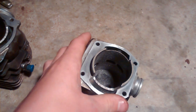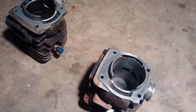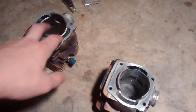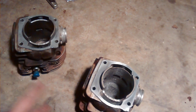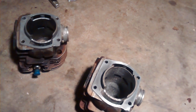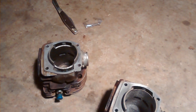My 372 I just rebuilt - I'm going to take the cylinder off, port it, and that'll give a little bit of power gain. When I get done with it, it'll have a dual port muffler, unlimited coil, and I'll eliminate the base gasket when I port the cylinder - just put silicone on it. I'll have an eight tooth sprocket, and I want to try to build a velocity stack for it - maybe get a green weenie or something. I'll do that one of these days when I don't need it.